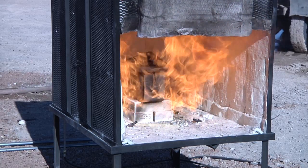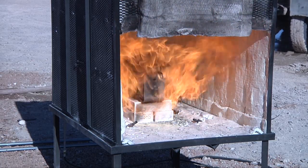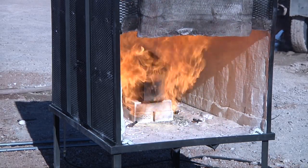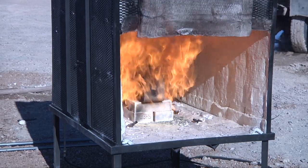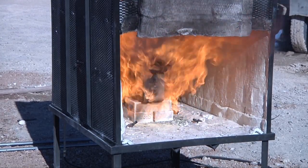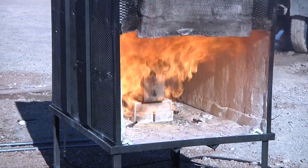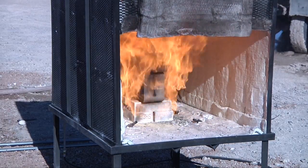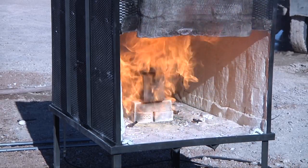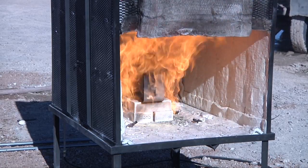It's part of our technology — no moving parts. We're using the chemistry of water to protect against fire. It's kind of like a pot of water on your stove: you can keep adding burners, but the water never gets above the boiling point. When all the water goes away, the pot can obviously melt. As long as the IOSafe Solo has water in the insulation, it's going to withstand the fire, designed to withstand better than typical house fires and business fires.